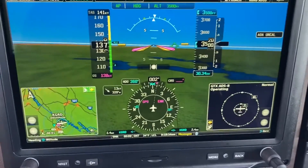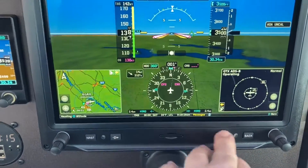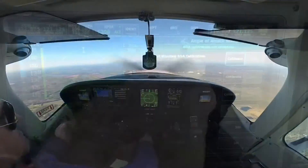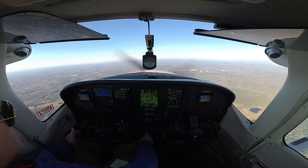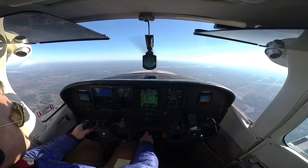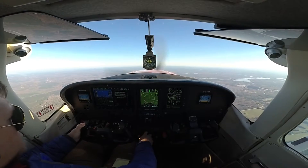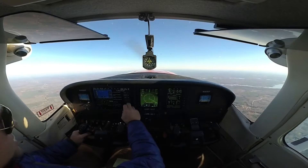I've got to fly several V-speeds. If I go to the menu, Set Up AOA — I've got to calibrate stall warning. I may have to turn off ESP to do this, because the airplane keeps the nose up. Going to slow the airplane down to 50. Actually going to turn away from the sun a little bit so we can see it better to calibrate the alert. I've got to get slowed down to 52 knots. There's the factory stall horn going off now. So there's 52 — that one's calibrated.